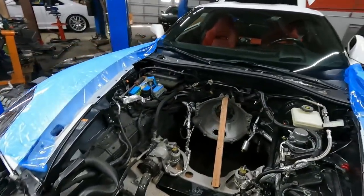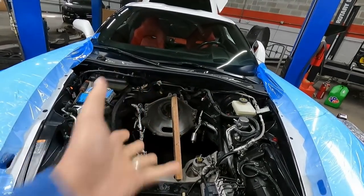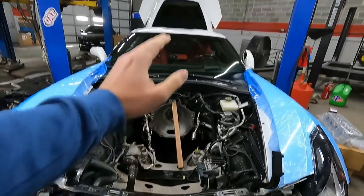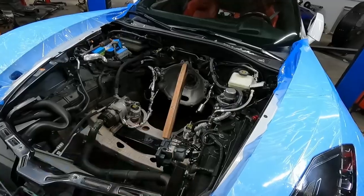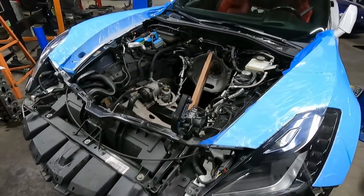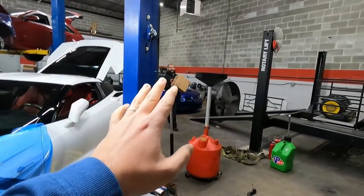And to get to that, we're gonna actually just drop the torque tube now, pull that forward, and put the converter in right then. So this is actually a pretty convenient job because we don't have to drop the rear like we normally have to in order to get to a converter. We're gonna do it right here. It's gonna take a couple extra minutes. So convenient. And when we do this, we'll do the new GM fluid.